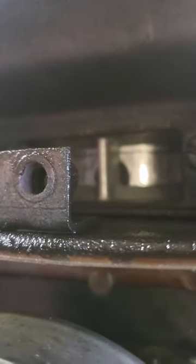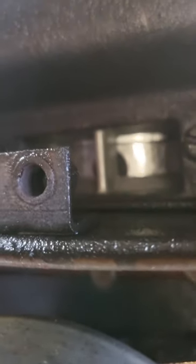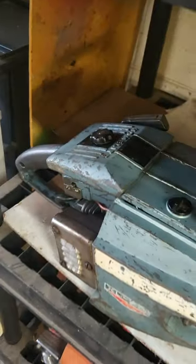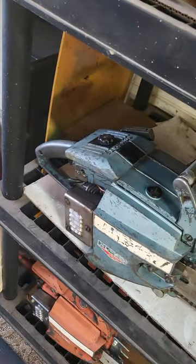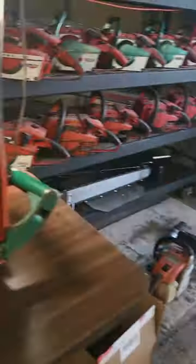i.e. toward this muffler, where the split and the rings are, it'll catch the port here, the exhaust port, and tear up the rings, tear up the cylinder, and tear up the piston. So it's pretty expensive if you get it on backwards. That's exactly what happened to this 901. But I have a good used cylinder and piston. But anyway,